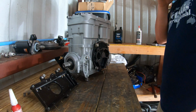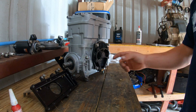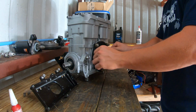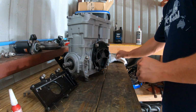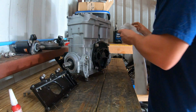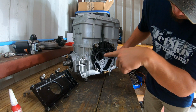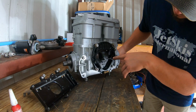So that is done. Now I'm going to go ahead and start getting the oil pump set up. It rides on a gear. Yeah, it meets in here. Just like I said though, this is my first time doing it. Make sure my O-ring is all nice and clean. There's no grit, nothing in here. The rotary valve, I did rotate everything, make sure everything's rotating smooth. As you can see, the rotary valve, you see how this was covered? See, it comes around. And then now this one's going to get the oil and air mixture, with the fuel. And that's how it circulates itself.